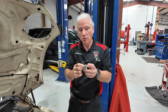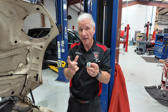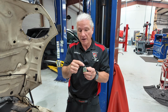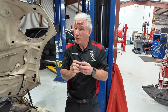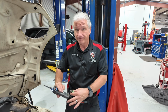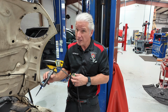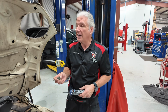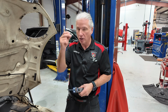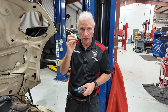So we're going to have a power and a ground, or one of them's going to be applied, one of them's going to be on all the time, usually, not always, and then we're going to have power coming in and power going out, right? So if you put that power probe on the wrong terminal and you hit that power switch, or even hit that ground switch, you could potentially, quite easily and extremely quickly, burn up a module or burn up whatever is controlling this.